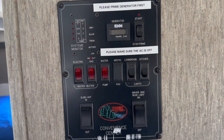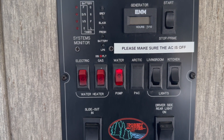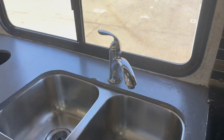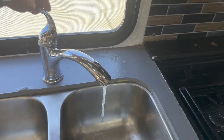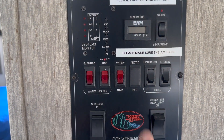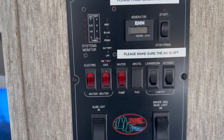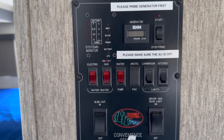For the main control panel, from here you can control the water pump. If you need water in the shower, sink, or to flush the toilet, and you're dry camping or driving on the way there, turn that on. When you're not using the water pump, always turn it off. If you're hooked up to city water, you do not need to have the water pump on — the water pressure from the city water will be enough.